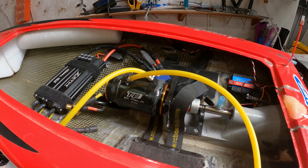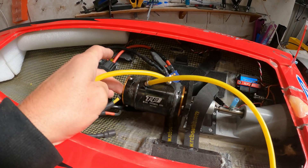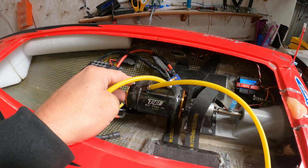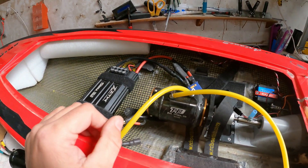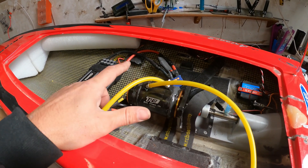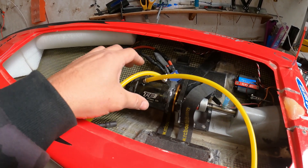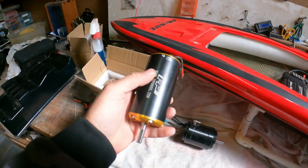The lowest kv I had available in stock was one of these TP 58mm by 90mm motors — this is 490kv — and I ran that on 12S and it was an absolute animal. I should have videoed it. But the combination of it being a Y-wind motor rather than a D-wind didn't help things, and the thing just got so hot it wasn't funny.